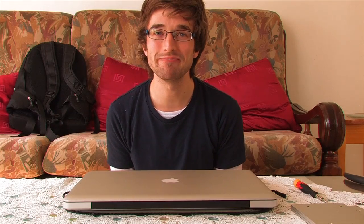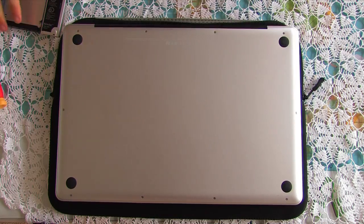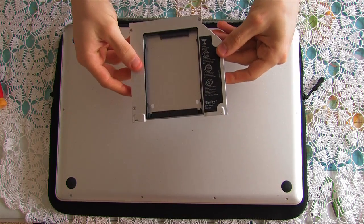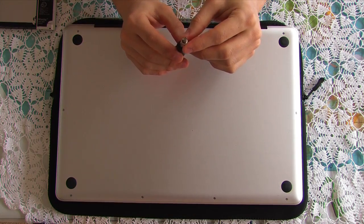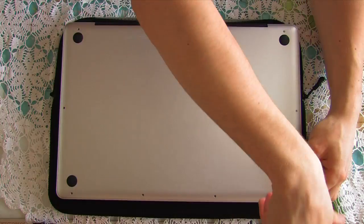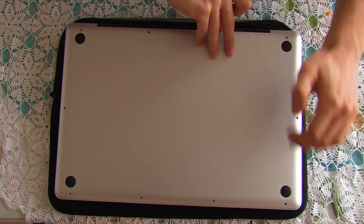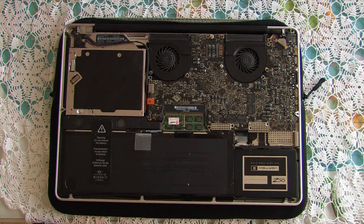So let's open it up. For the sake of this video I'm going to be opening up a 17-inch April 2009 release MacBook Pro, and to the best of my knowledge the Nimitz hard drive caddy will install in any unibody MacBook Pro. To open this up I'm going to be using a small Phillips screw head and taking out all the screws around the peripheral of the laptop. Once that's done just hook your fingers down by the hinge and pull up gently, and the whole back comes off — that's the inside of your computer.